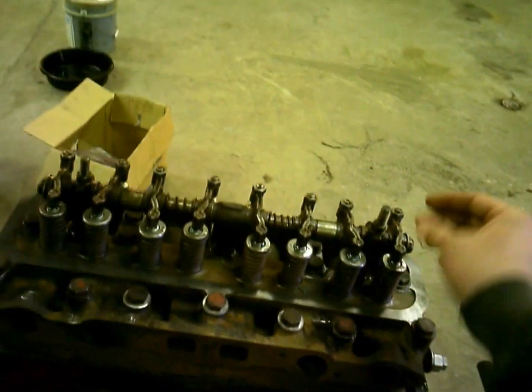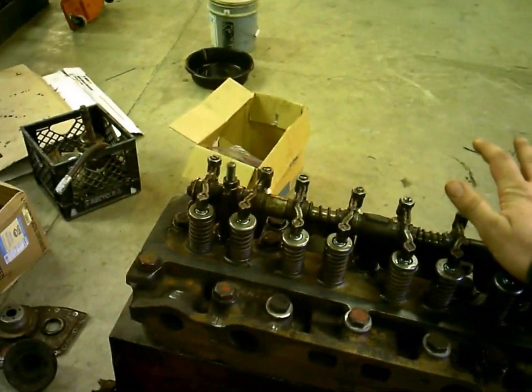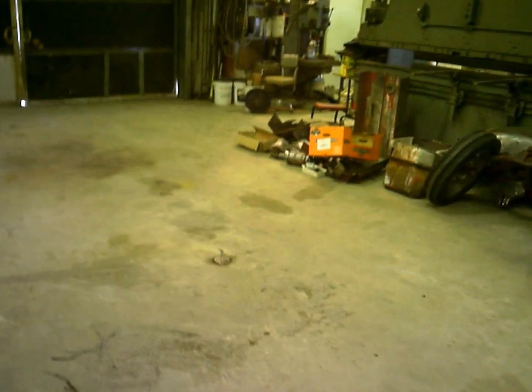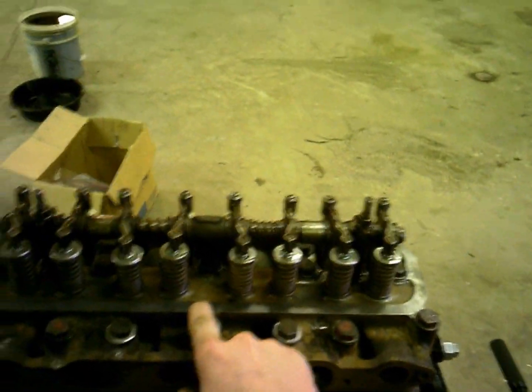You go and put the valve cover on. It's got a cork gasket sitting there. You only tighten those things. I probably only tighten these bolts to, like, you're supposed to torque these valve cover bolts, that fine thread 3/8 bolt would go to 30 foot-pounds on a grade 5, but I'll probably only go to like 10 or 15, and the reason being, just those cheap tin valve covers, they bend and they'll deform, and that cork gasket never seals up that well anyways, especially if you tighten them too tight. It just kind of smashes them out.